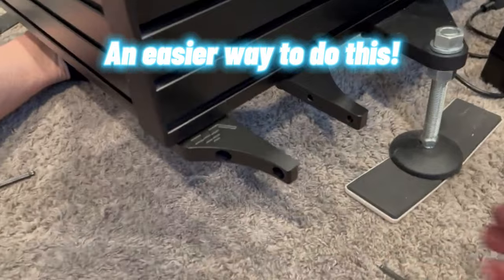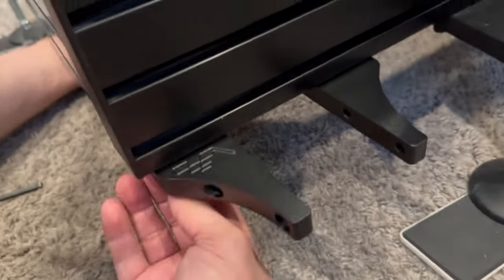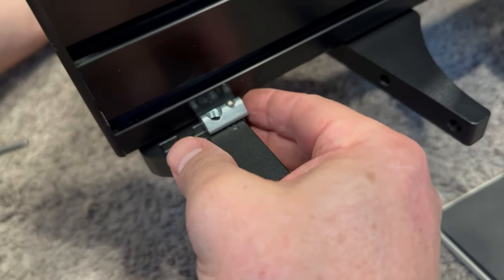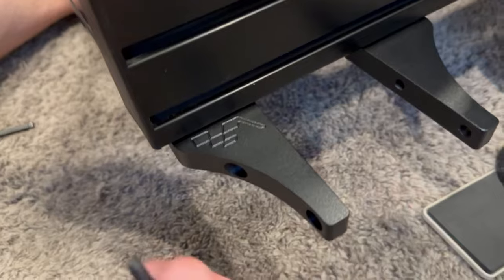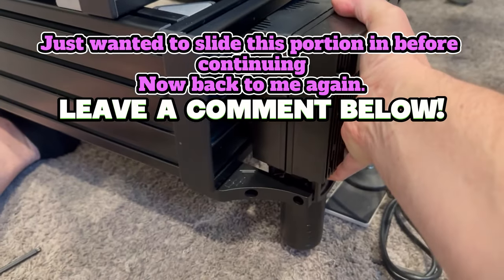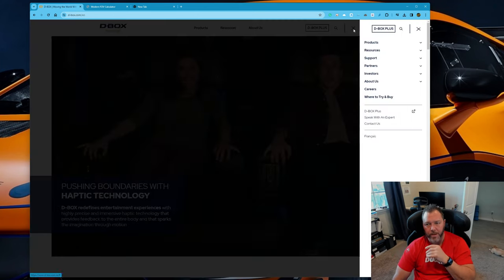A quick tip: since you can't see underneath your rig too well without jacking it up, you have to work by feel when placing T-nuts. I'd put the threaded side pointing inward on both sides. When you slide the bracket onto the rail to the correct hole position, you can easily trace and install the nut correctly. Suggest putting these on first and leaving them a little loose so you can slide them around, then slide your actuator into place and install the other screws.